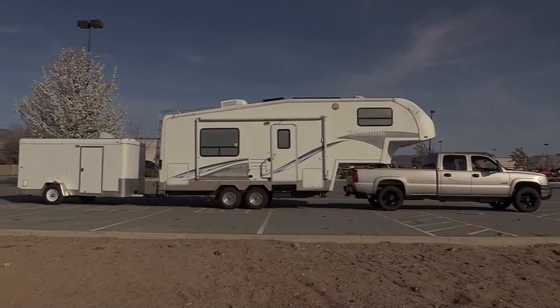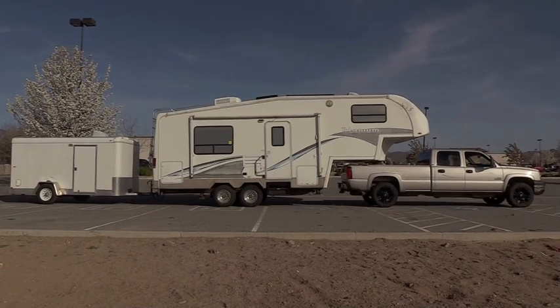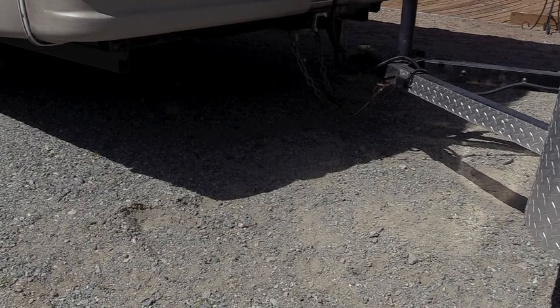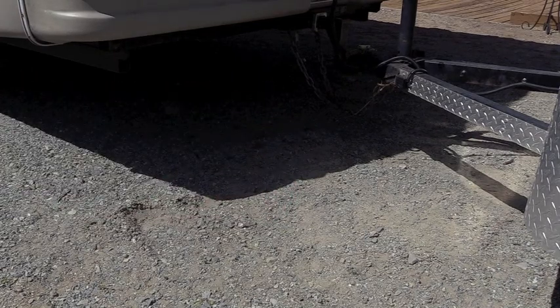I want the weight distribution so there's not so much pressure pushing down on the hitch — it will spread that weight forward and back onto the fifth wheel trailer tires and back to the cargo trailer tires. I double towed a long time before I started bending the back of the fifth wheel frame. I hit a huge bump which put a lot of pressure down on the ball — that's where I believe the frame bending started. Most fifth wheels, including our Glendale Titanium, were not designed to tow a second trailer. I also considered a trailer toad, which adds another axle underneath the ball to support the tongue weight of the second trailer — I think that's the way to go for double towing.